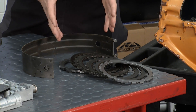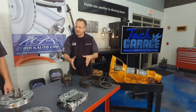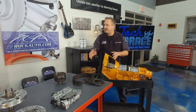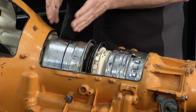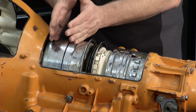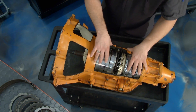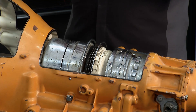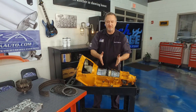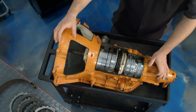And then we move on to the clutches, which are around the outside of the planetary gear set. These clutches either hold or drive one of the planetary gear sets. There are also bands around the outside, and they hold the planetary gear set depending on which gear you're going to go to. All of those elements are stacked right here — a clutch pack here and a clutch pack here, both on top of planetary gear sets. Between the gear set and the bands, they either hold or drive different elements, and that gives you the gear you're looking for, whether it's a forward gear, reverse, or neutral.